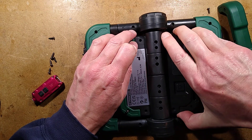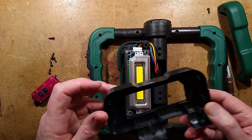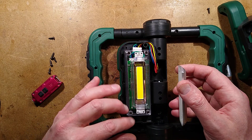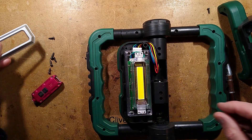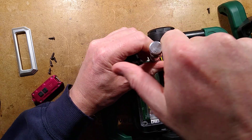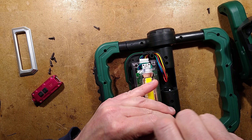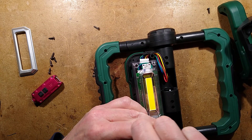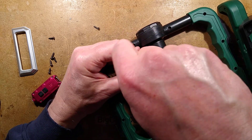It's making crunchy noises but not opening - and there we go. For reference the front comes off like this. I don't see batteries in here; I see a completely sealed module with all the electronics under a cover. It's got a connector at the end that connects to the other side. I'll take a picture of the circuit board and analyze the circuitry. I'm expecting a USB charge circuit and a simple microcontroller with the button switching two transistors, one for either side.